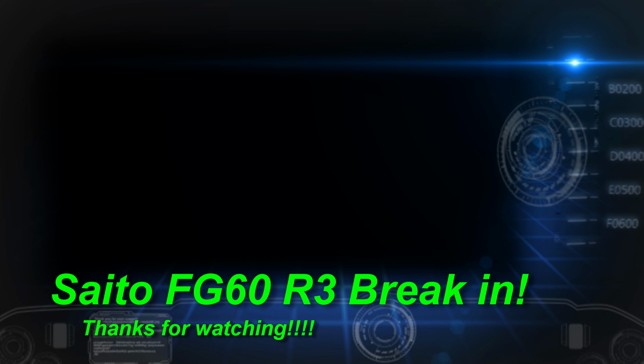All right, so we're here. We're breaking in the new Saito FG60 right here. There's a lot of break-in stuff out there, but nobody shows what the needle values are that they were using. So I'm pretty much going by the manual. Over here, the low speed needle is inside the throttle, in that little circle. How I set that for break-in was I closed it all the way, and then I backed it off 7 turns. And that's your low speed.